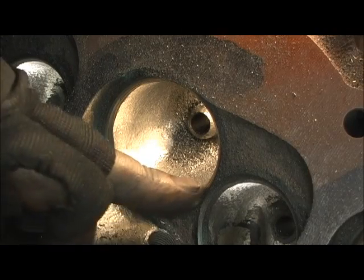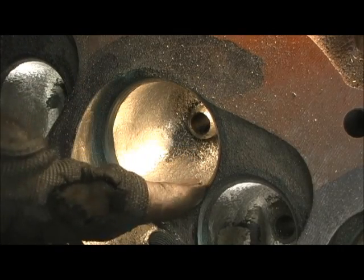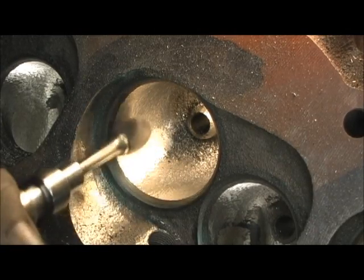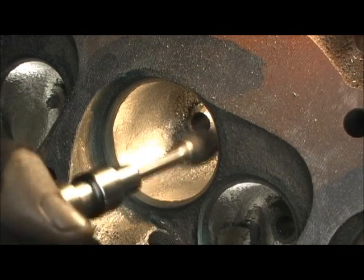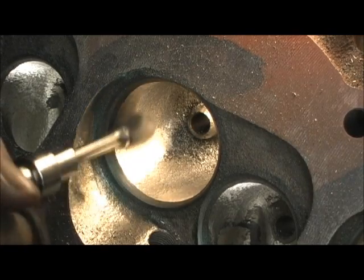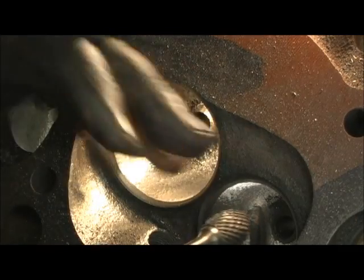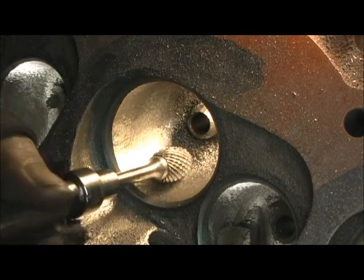That line sure is rough. Like I said, I take this and just chump-pull to where I can't feel any humps, then I'll have to go in there with the smaller cutter and pull it in. Back here I can see where the line is — the reflection of the light. When you position the head differently it pulls into that line. I always make sure I get before that line, not to it, till I can see it better with the light.